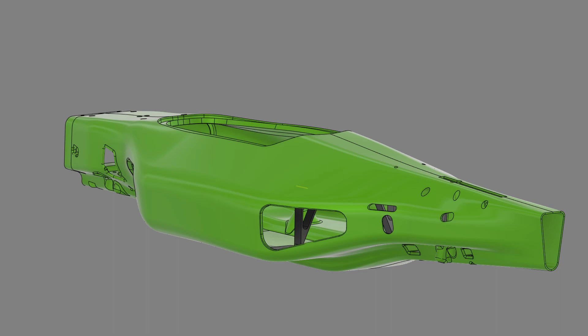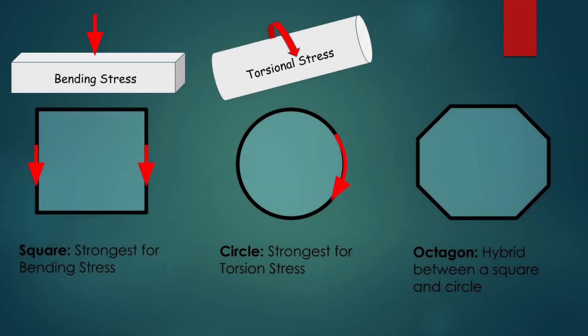Since the monocoque is structural, let's start off by discussing the actual forces acting on it. The biggest force is a bending stress, primarily in the downward direction, caused by the weight of the components housed in the monocoque as well as the forces from the suspension pushing up on it. The rule of thumb when designing a monocoque structure is to have as much material as possible aligned in the direction of the stress. In a purely bending situation, the strongest monocoque skin profile is actually a square tube, with walls on the sides directly in line with the bending stress, giving you the most strength possible just from the skin of the structure.